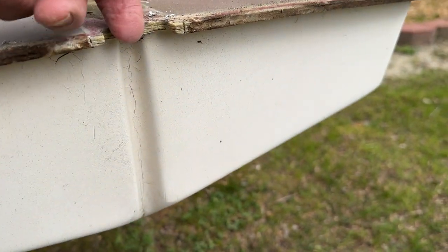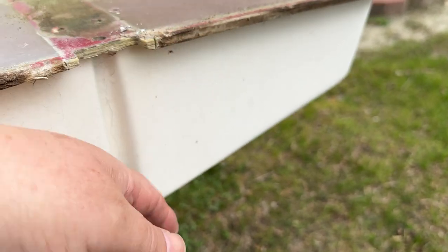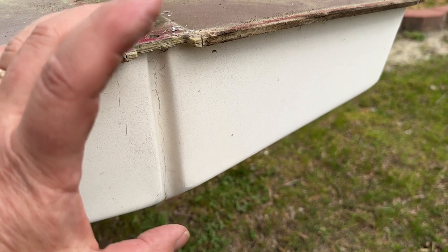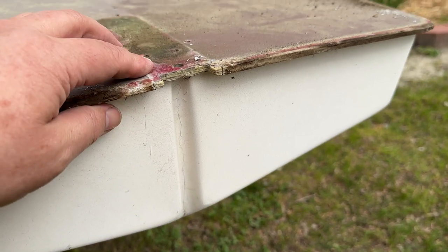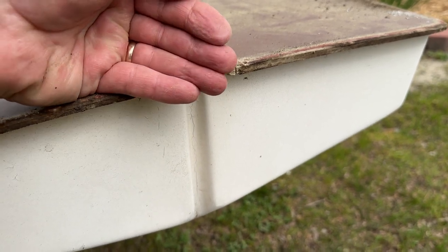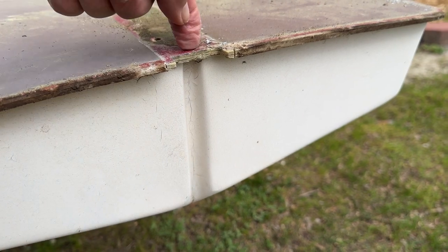The last interesting feature: these early fiberglass boats have a little cove in the transom where the carriage bolt goes down through this hole. It holds the horizontal hinge plate that the rudder assembly swivels on. The little latch plate comes off the bottom, and the vertical hinge plate comes down and snaps into the carriage bolt with a thumb nut, and a spring plate on top holds all that together. This is the same type of hardware they used on the wooden boats.